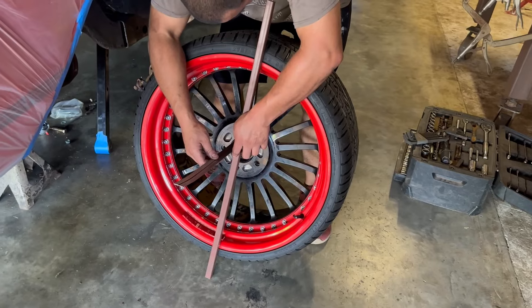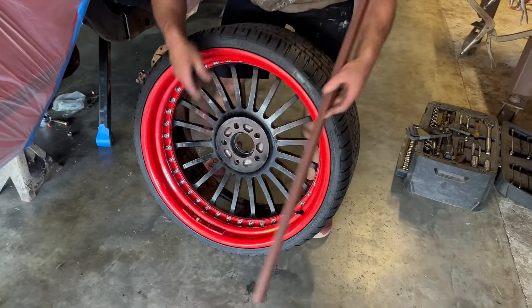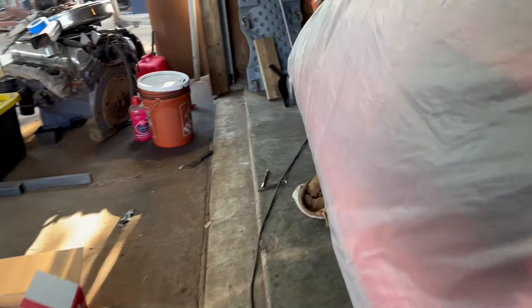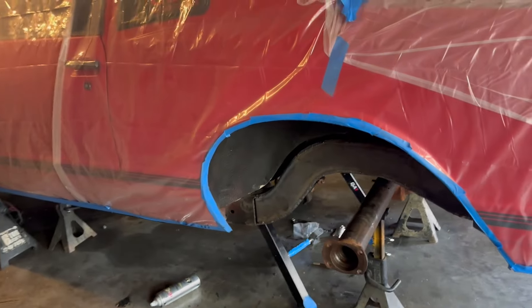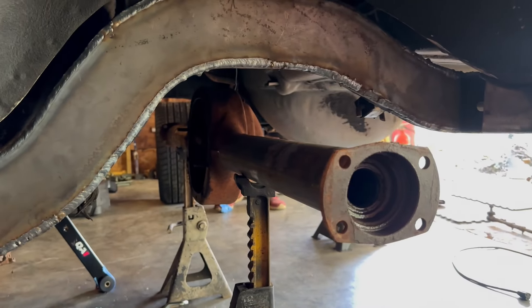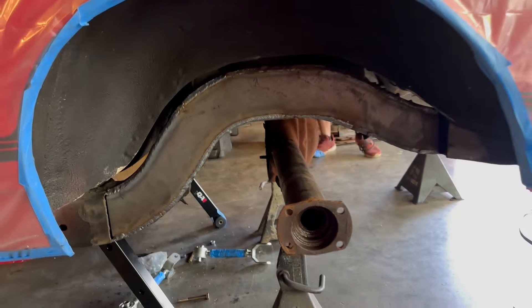The back spacing should be like three and three-quarters. So for the rear end — right now that's centered — the pinion is centered right there. You can see that's how much I've got to cut on this side. On a Ford rear end, the pinion is already centered and the axles are two different sizes. On a GM rear end, the pinion is off-center and all the axles are the same size.